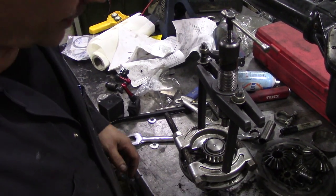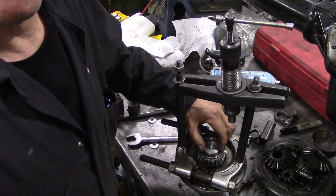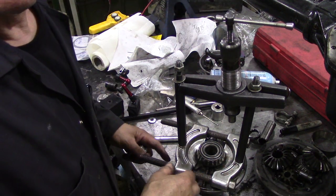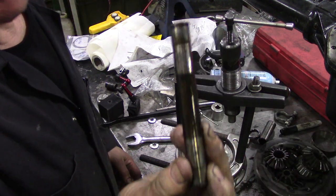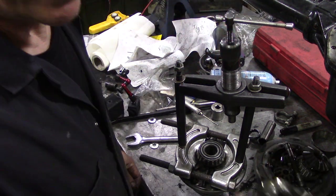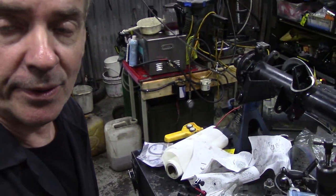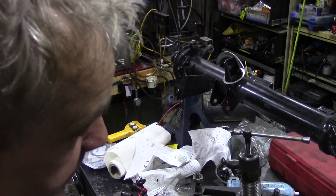Today on this little video we're going to be trying to get the bearings off the rover type of axle. It is a bit of a problem because there's actually two sizes. The hole in the casing was slack where the pin goes, so they sent me another diff, but unfortunately it's a 10 spline metric. How do you tell the two apart? Well, on the casing, if the bolts are marked 8.8 it's a metric 10 spline, otherwise it's an imperial inch size.